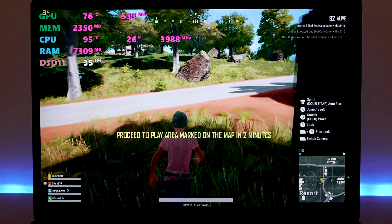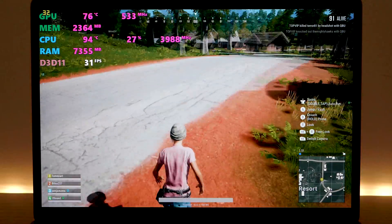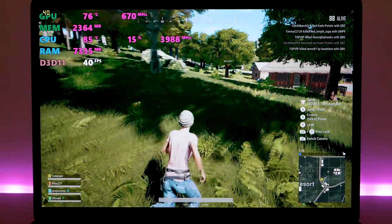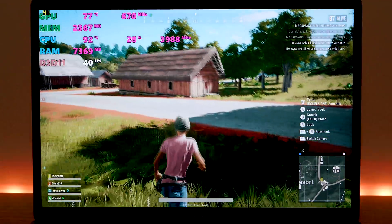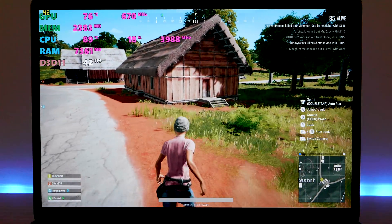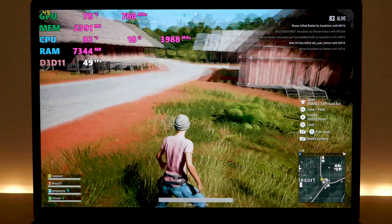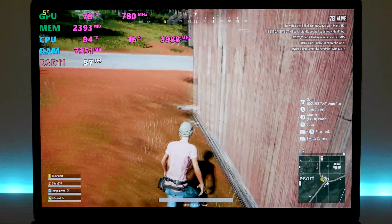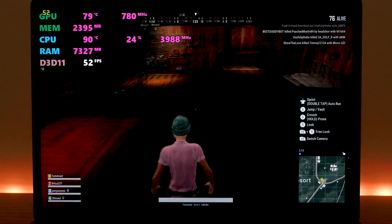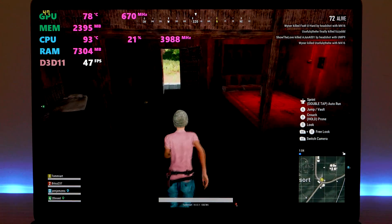If you do not follow my steps to control how fast the CPU goes and control the heat, you will get throttling issues — this will throttle gaming. When I gamed for a long period, I noticed the battery was draining and the VRM was power-limit throttling. There are two things here: one, the power unit cannot supply enough power when you're gaming; and two, the VRMs are thermal throttling. I would say this is a potential point of failure. The VRMs aren't built for this sort of intensity — they just needed to put better VRMs in there. But I think it's VRM throttling and CPU throttling, and it would be a performance degradation issue rather than a failure issue. We would have seen these VRMs fail from the 2016 and 2017 models by now, because throttling down means you're not putting any more pressure on those VRMs — it won't allow you to boost higher.